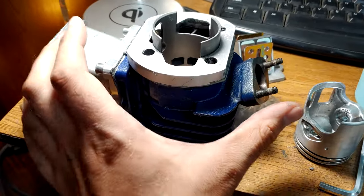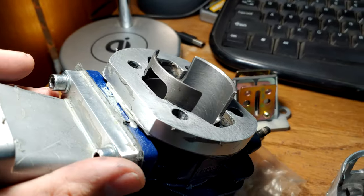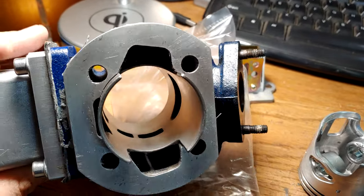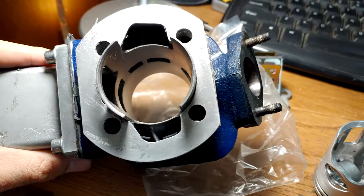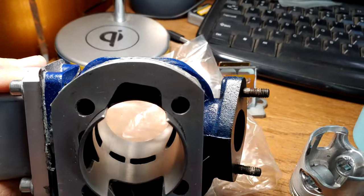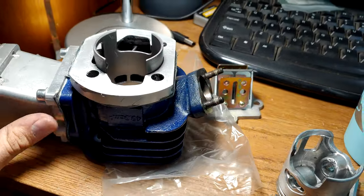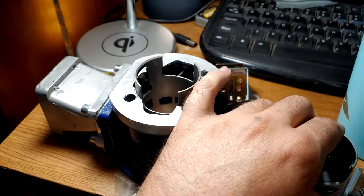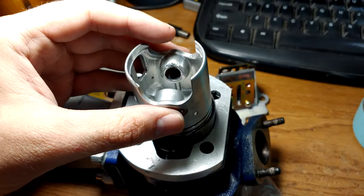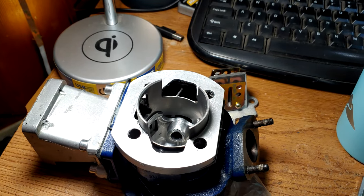I had never used one of these before, and the majority of videos I watched about how to use them were on four-stroke motors. Tutorials on four-strokes are simple because they don't have ports, and they don't have to emphasize just how important it is to make sure you get every last bit of this honing compound out of the cylinder. Through a combination of ignorance and laziness, I didn't thoroughly clean the transfers or intake adapters. And this cost me severely.